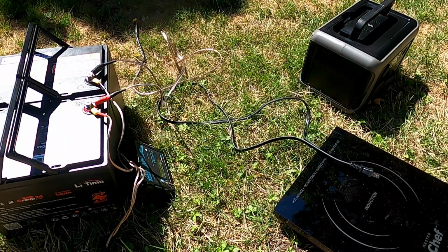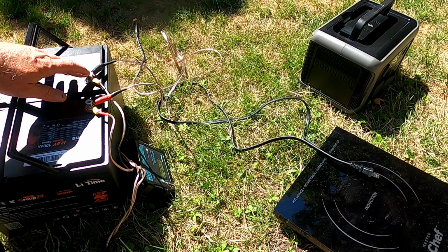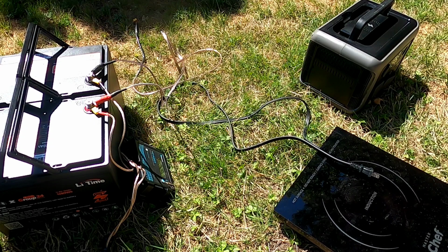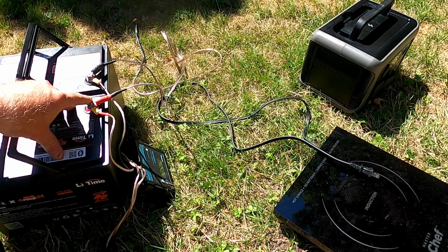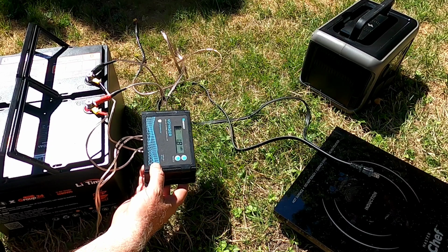Okay, so I just hooked up those couple of wires to the terminals. Like I say, all the positives to the positive, negatives to the negative. Now you don't want to go beyond 3 connections to a terminal like this. If you get into more complex wiring systems and you need to connect more than 3, then you're better off connecting to a fuse block and then going out to that. I've shown how to do that in previous videos.